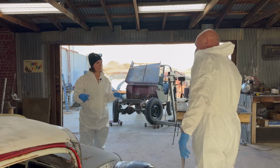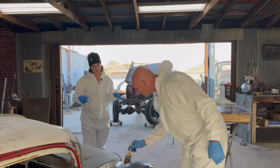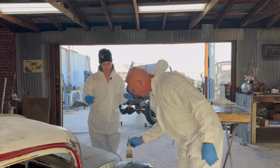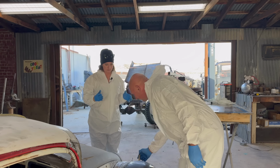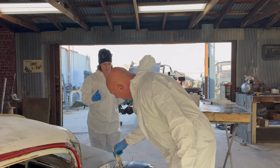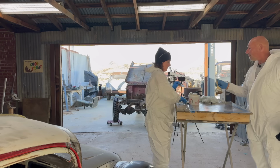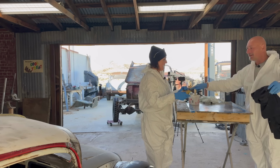This is the Bob Ross moment. And then every little fiber that's sticking up, you'll want to sand off because you want the next layer to be laminated perfectly smooth. But if you take this, see, just as it's really sticky, you can push it down, you can push all the air out of it, and then all the little fibers will lay down. But you store the brush in the acetone so it doesn't turn plastic hard.